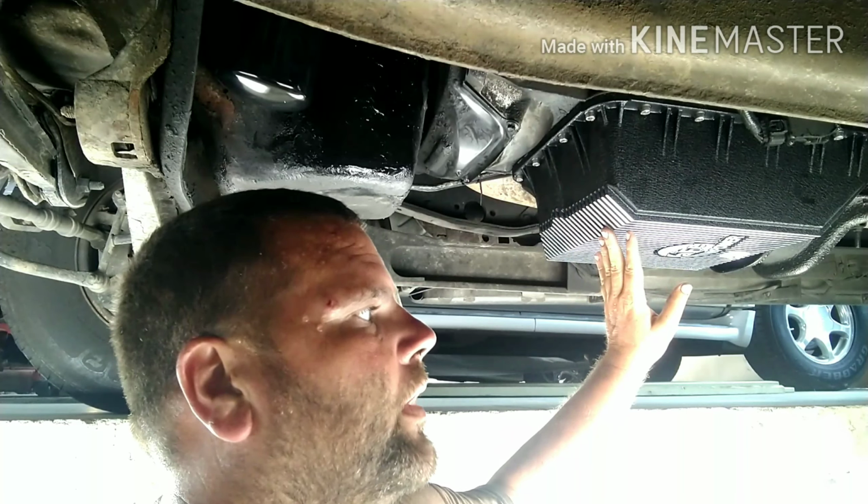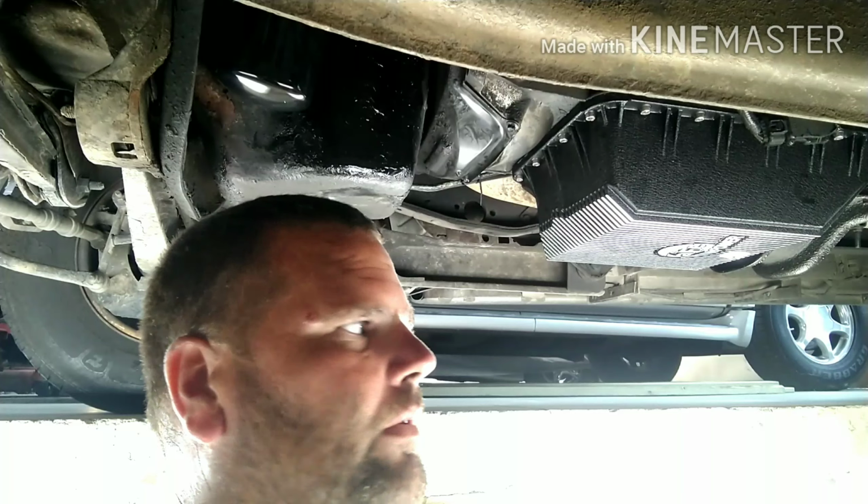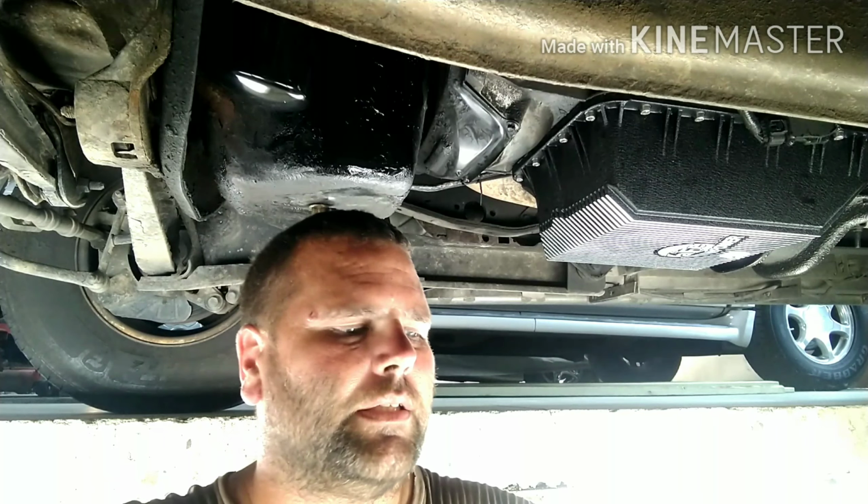The other thing that we did, we ended up putting a larger transmission pan on here. 2 things had to happen. One, I was getting a little warm on the transmission. I have a digital transmission gauge in the truck, and I've noticed it getting about 5 degrees hotter, and then it went to 10 degrees hotter than it normally ran, than what it's supposed to. Typically, I like my transmission to run cool just like everybody. On these older trucks, they say 183 to 187 is normal while you're pulling a trailer. I don't like mine over 173. Typically, out on the road, running down the road, I'll be about 164, 165 loaded, going down the highway at 70 mile an hour. That's where I like my transmission temperatures at.